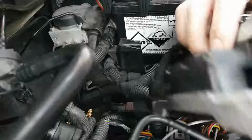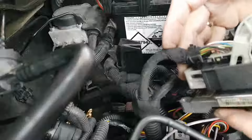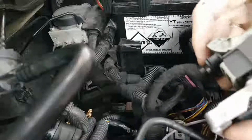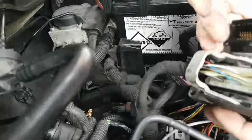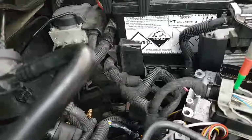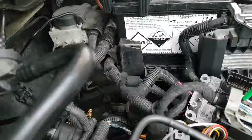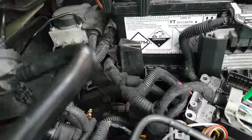It's not that one, it's that one in there. Bloody hell. They broke everything in this module, guys. Bloody hell. Let me cycle the ignition. Okay, and with the ECU plugged in, on those 2 wires, I have 9 volts and a half. I should have 12 volts, I guess. I'm not sure which one is the main relay for this. Let's see.